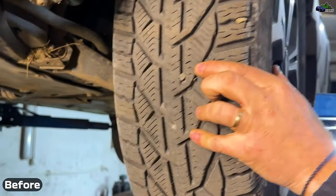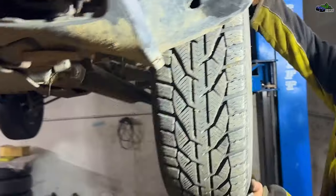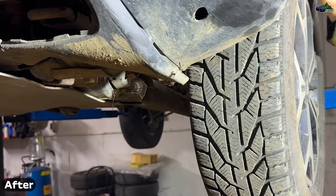At the beginning, I wasn't quite sure if the bearings had to be replaced. In the end, I thought it through, and it was better for me and for the next owner if I replaced the wheel bearings as well, because with just the replacement of the steering rod ends, in about 1 year the wheel bearings should have been replaced, and they could also damage the new steering rod ends, and the next owner would also have to do the car geometry.